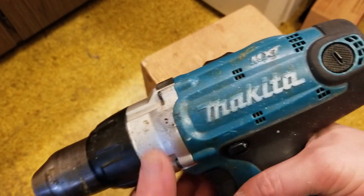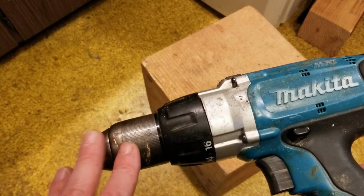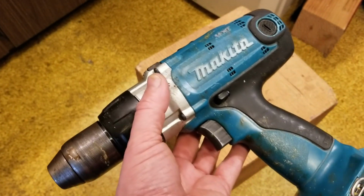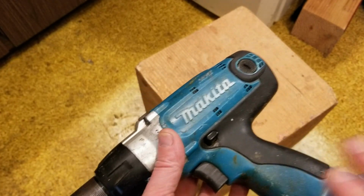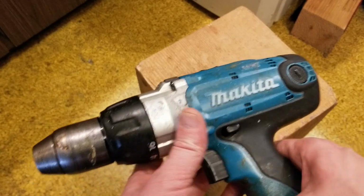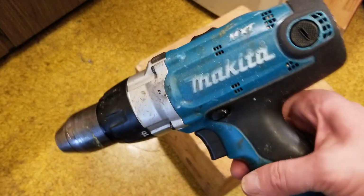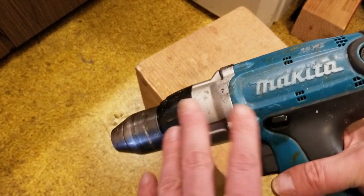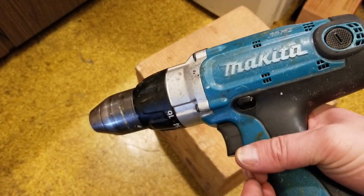The reason it behaves like that is the linear power supplies drive it continuously. When they drop the voltage, they'll still provide constant current, but that little black ham radio power supply is a switching supply, and so when it overloads, it turns off. So when I do this, it immediately overloads the whole system.